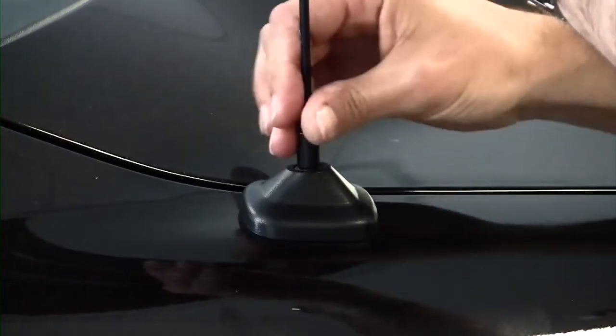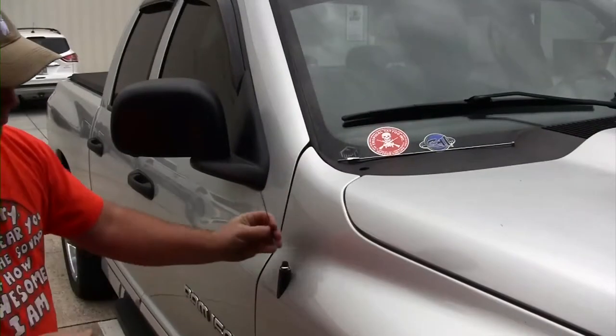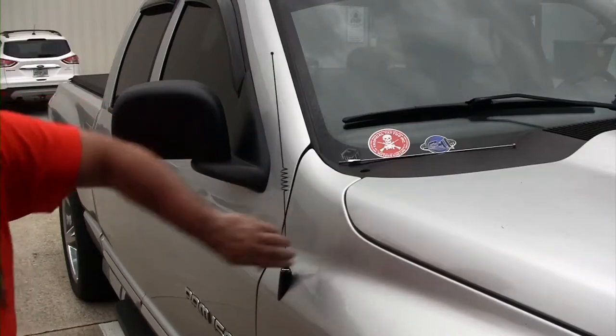It's that simple. Chrysler is the same thing — Chrysler antenna threading is different than what comes straight out of the package. So we'll grab one of those adapters, find the proper Chrysler adapter as noted on the back of the packaging, thread it into the antenna mast, and thread it onto the vehicle.